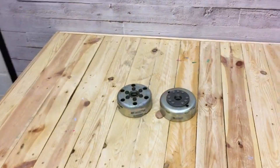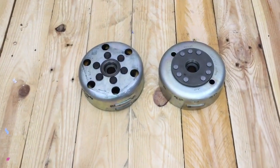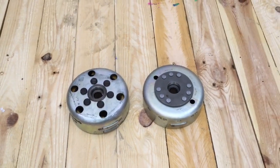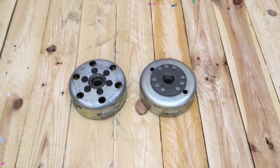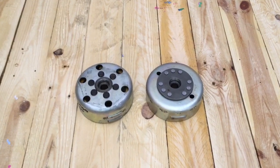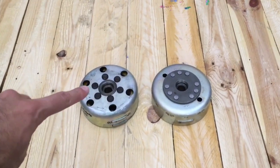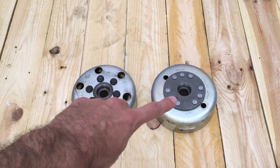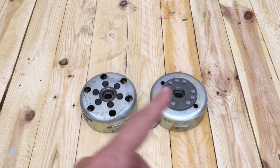In this video we're going to be talking about the differences in the flywheel from the SR250 Special to the SR250 Classic, and we'll be installing some advance brackets which increase advance by 5 or 6 degrees on the SR250 Classic. And if you're interested in the SR250 Special, go and check that video out in the link below. But this one here for the SR250 Classic we'll go through shortly. I'll set up the tripod and talk about the differences between these two flywheels.